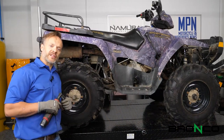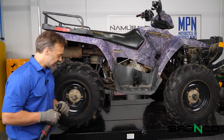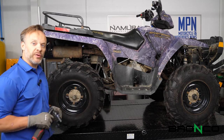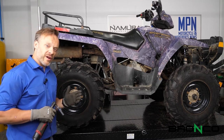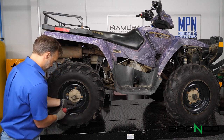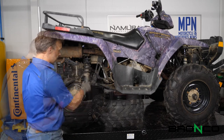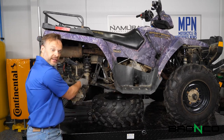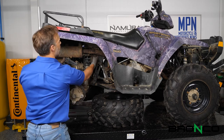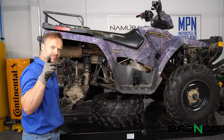I mentioned before that if we had time we were going to get to the rear shocks — and we've got time. You can do it without taking the rear tires off, but it's sure a lot easier to get them off. So we're going to pull these guys off and do the right rear first because it's a little bit tougher because of the exhaust. The joys of working on a used quad — there's mud in here. Nonetheless, these rears end up being pretty simple. There's one bolt down here and another bolt up here, and once we get those out, this thing slides right out and the new one goes right in.